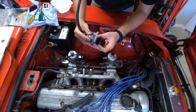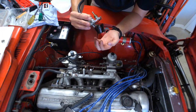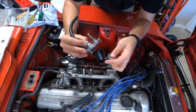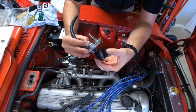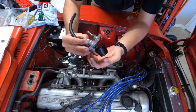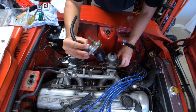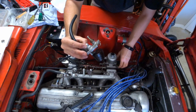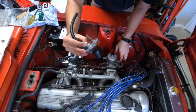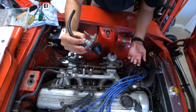What you do to adjust that tab is you slightly bend the float. It's important to remember that when you do this, you need it to be as correctly orientated as possible in the fuel bowl for that height. Don't just go bending it down because then it won't sit square in the bowl and it might jam. If it jams, it will hold the jet open or not function properly.